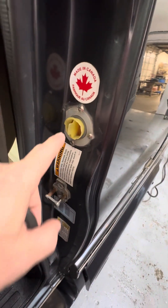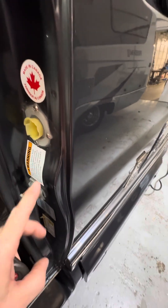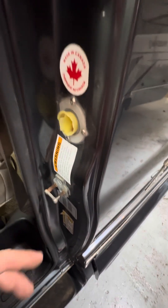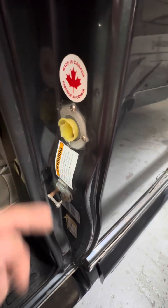Just inside the driver's side entry door there is a plug you can remove — the fresh water tank is at the bottom of this pillar, so you can gravity-fill it or pour bleach or tablets down inside to sanitize it. There is a drain valve on the bottom of the tank; open it and it will drain the water out.